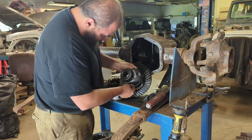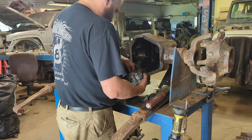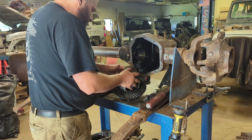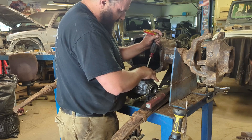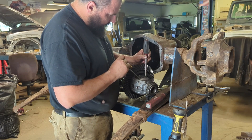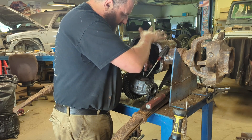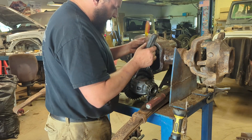The shim stayed on this one, so we can stick that back in there. We'll work these springs in here — get the spring pocket lined up. Once we get it in there, we can just push it down. It'll snap into place once it's seated all the way down. Get around to the other side and rinse and repeat. That's really all there is to it.